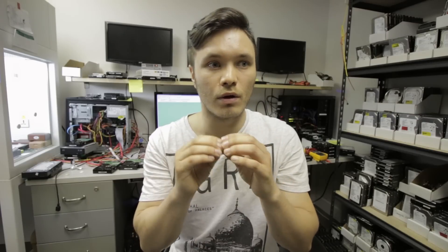As you guys can see behind me, the imaging process is being done specifically on that hard drive. I didn't expect to run into a problem with media cache, but it was quickly handled through the terminal. Now the biggest challenge in this whole process was to catch that moment where the read channel needed to be shorted out. That took me probably a good five to ten minutes of trying repeatedly, one attempt after another, because the window for that shorting period is so small that unless you get it perfectly, the drive is not going to unlock the terminal for you.